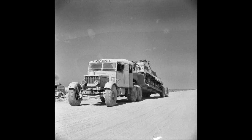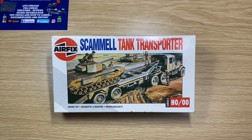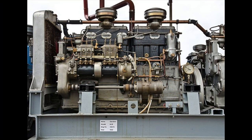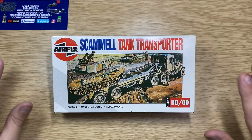It was designed as a 6x4 off-road vehicle for use in Britain's colonies where sealed roads were scarce. The Pioneer was first produced in 1927, and even though it lacked all-wheel drive, its suspension with great travel, excellent traction, and a low-revving engine gave it impressive pulling power on rough ground at low speeds. They were produced between 1927 and 1945, in service from 1932 right up to the 1980s. The engine was an 8.4-litre Gardner six-cylinder diesel with 102 brake horsepower, a constant mesh gearbox, and a maximum speed of 24 miles per hour.